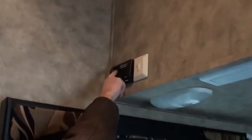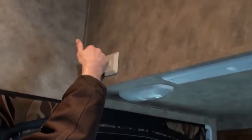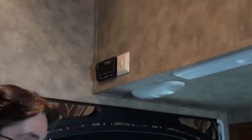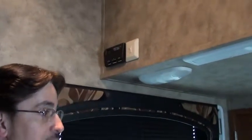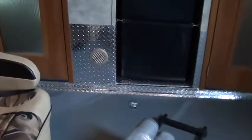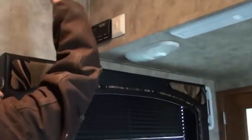You have a thermostat here for this air conditioner that's above these beds. You also have a heat strip in that air conditioner. You have up and down for temperature. If you want to go up, you push up, down you push down. But on heat, just the fans are going to come on, and it's kind of like a hair dryer. You've got a heating element, and it's like a big hair dryer that'll blow out. If it's 20 degrees, it's not meant to warm this area. It's meant for spring mornings when it's cool, just to get the nip out of the air. That's all that one's for. If you need heat, there's one register that'll blow heat from the main furnace out here. So keep that in mind. This works this air conditioner. You have another one up there that we'll see here in a little bit that works the other air conditioner.